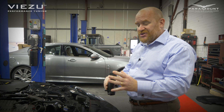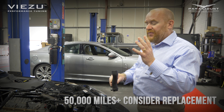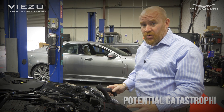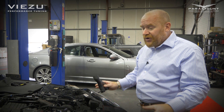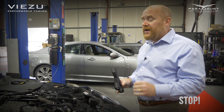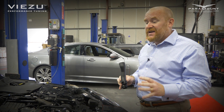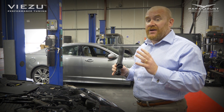If you haven't had yours changed, it's a really good idea to get it done. Certainly if your car's done 50,000 or 60,000 miles, it's well worth looking at. Because when these fail and this literally splits, it can be a major catastrophic failure straight away — the engine literally dumps all of its coolant very, very quickly. This normally isn't just a dribble situation; your coolant is gone. If you're going down a motorway at 70 miles an hour and that happens, you need to stop really quickly. If you suspect you've got a coolant leak on this particular engine, make sure you stop and get it investigated quickly. Do not be tempted to drive on to the next service station. If it's failed, it can fail catastrophically.